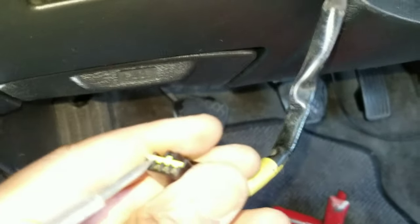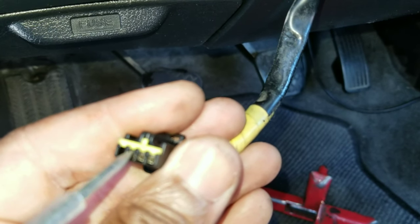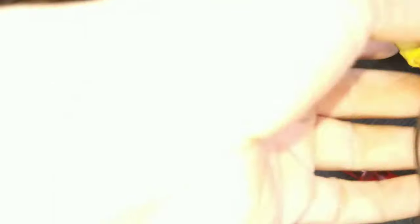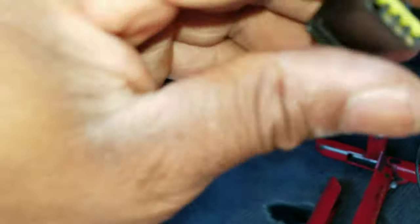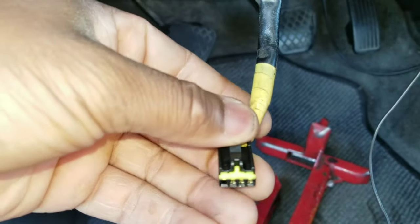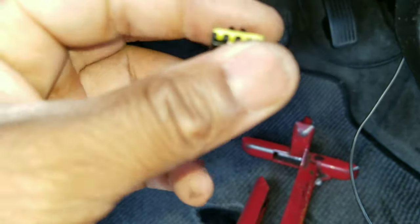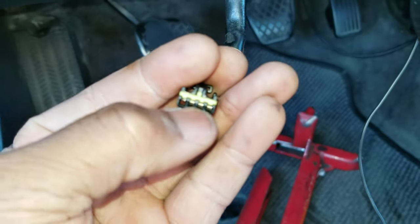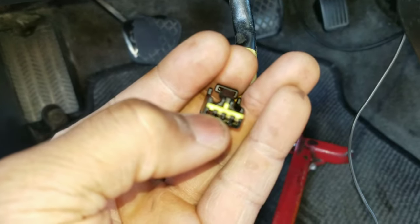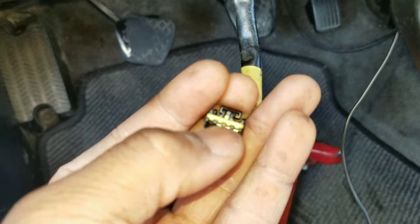As you can see, he's gonna touch it. Do it again — one more time. There we go — you see it makes the horn go off. Thank you son. With the connector facing this way and the actual release mechanism at the top, my horn pin is the first one on the left. So obviously we need to tap into that wire to make the horn work.